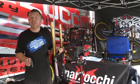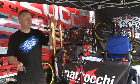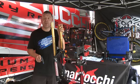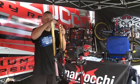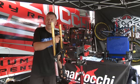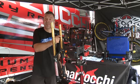For 2012, the features of this fork include spring preload on the right-hand leg and an air volume progression adjustment, which is this silver adjuster. The red adjuster is for rebound and the gold adjuster on the lower left is for compression damping.